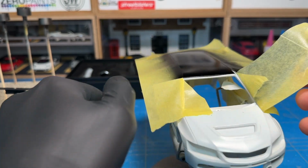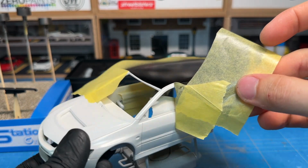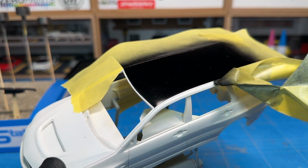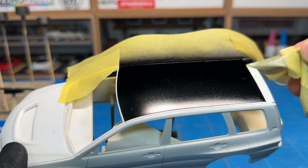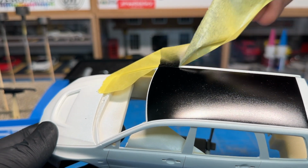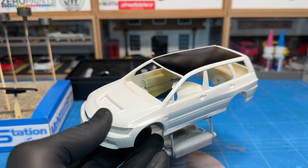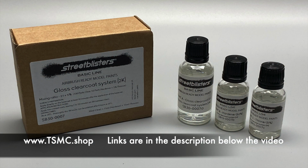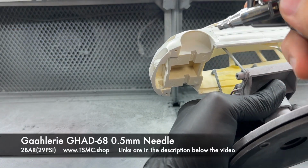And the paint did go really nicely, exactly how much I wanted it to and where I wanted it to, and the overall finish is pretty good. Now there was a little bit of dirt on the roof and a little bit of dirt landed in the paint, so the overall finish is not as smooth as I'd like it to be, but after the clear coat is applied, that should smoothen out a lot and achieve the result that I'm after, if there isn't too much dirt landing in it while it is curing.